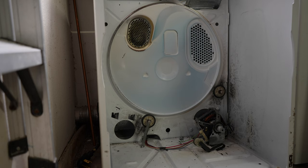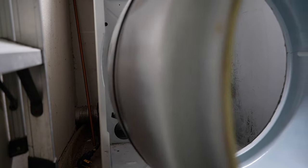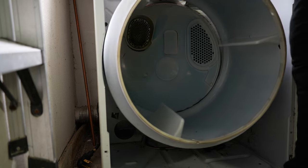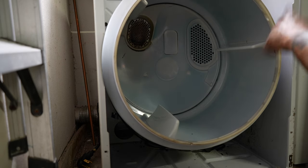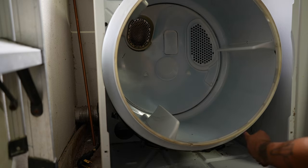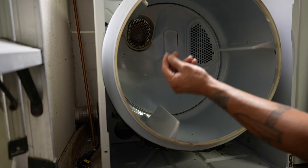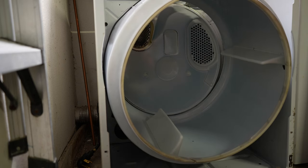What I've done is put my belt around the drum — I'm basically carrying the drum with one hand and holding it by the belt in the other hand. I'm going to slide it on in here. Make sure you put the furry side in — it's going to sit on top of those wheels around the outside. You'll know where it's supposed to go when it sits; it should be flush with that ring around the outside. Now you've got your belt on it. What we'll do next is go underneath — I'm going to try to get you a better angle with some light so you can see what I'm doing with the belt and the tensioner down there. You want your belt with the flat side facing up and the lines on the inside facing the drum.